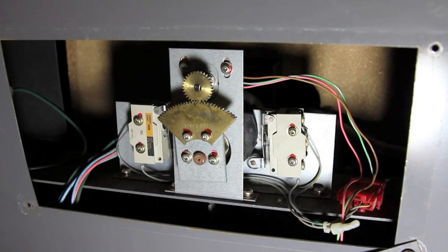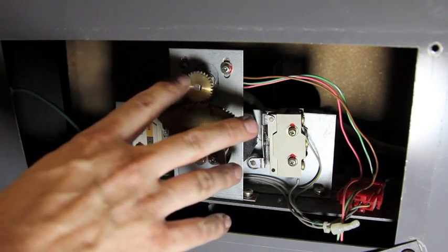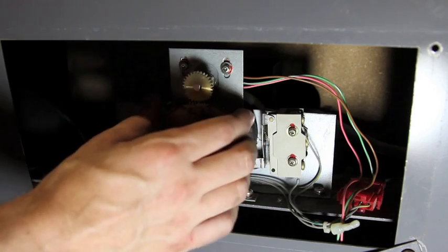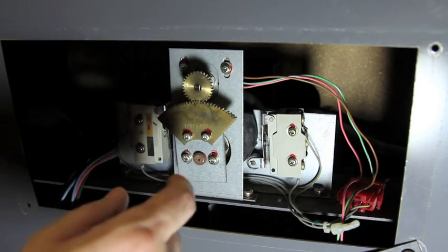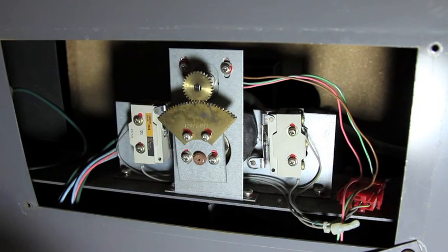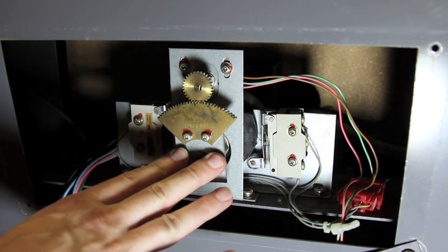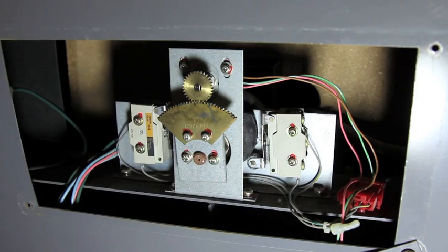This is the access panel in the front of the cabinet. There's a similar mechanism on the side — this is how the board gets its feedback on the movement of the cabinet. There's a sector gear here that hooks to a spur gear that's hooked to a potentiometer. So as the cabinet rotates, this moves back and forth, moves the potentiometer, and gives feedback to the cabinet to tell it where it's at. There's also a limit switch on either side to keep it from going too far. The one for the pitch motor is actually in the post on the side of the game. If I power cycle the game we'll be able to see this mechanism move and see how the feedback is generated.